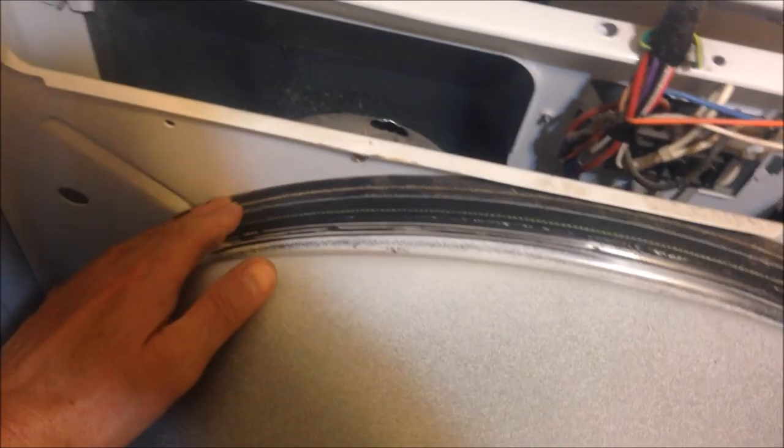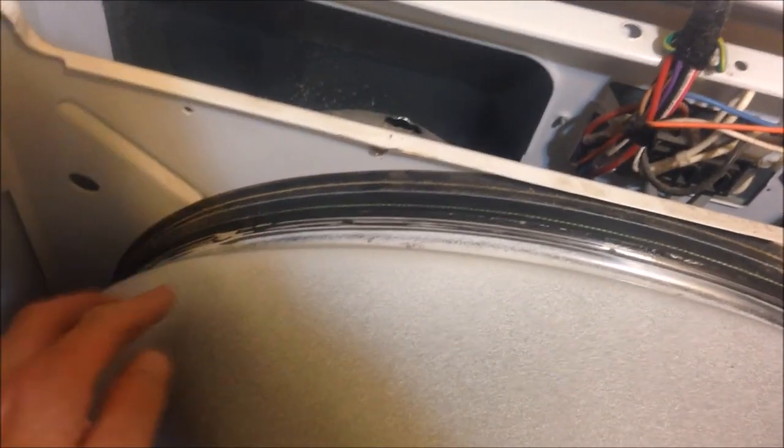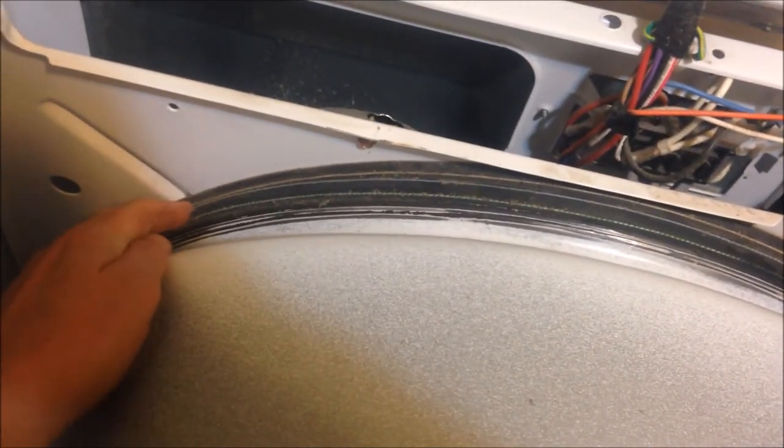So the next thing to do is install the drum into the dryer and then put the belt on. You want to set your drum inside the dryer on those two wheels that we just installed. You want to make sure that your gasket is fully seated around this ridge, and I do that by spinning. I'm supporting the edge of this drum with my leg and spinning the drum all the way around. I want to make sure that that lip isn't curled somewhere back under there, and that will tell me everything is in place. When I've got that right, I'm going to put the belt back on.